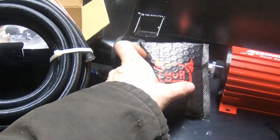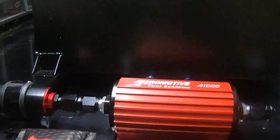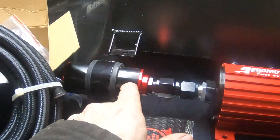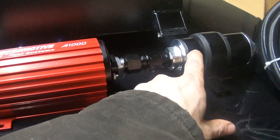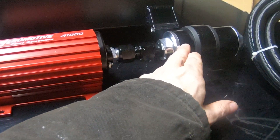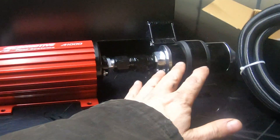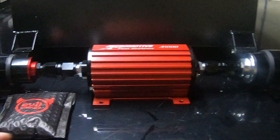This right here is a Y connection. We'll mount the fuel cell and the lines come in this way. This is the 100 micron filter and then the 30 micron filter. They actually call for a 24 micron, but I couldn't find a 24, and I didn't want to go down to a 10 from a 24, so I went with 30. This is the whole set — it's got line, fittings, and everything.